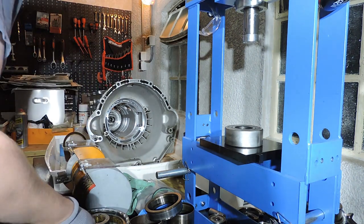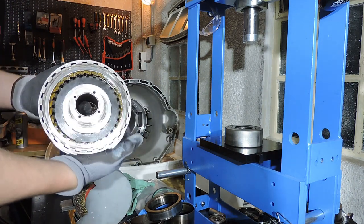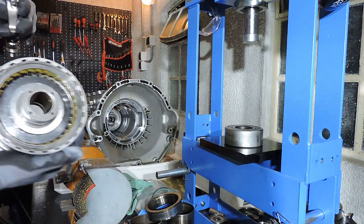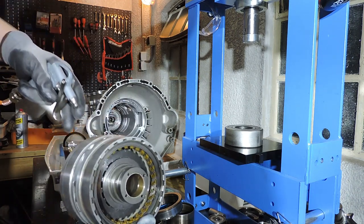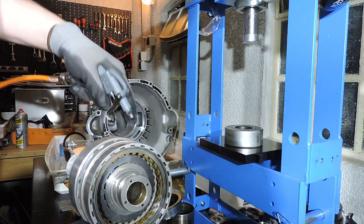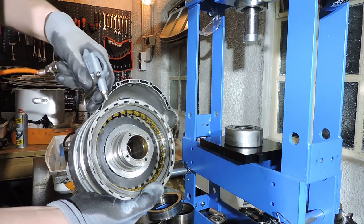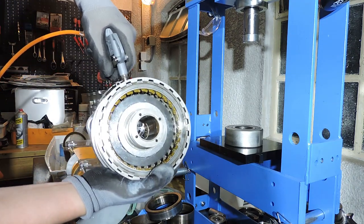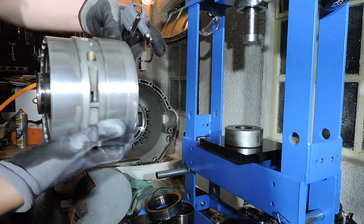All right, got some new gloves. Before we're going to put that DG drum in, we can actually test the clutch actuation with air. And what we want to see when we apply air, we want to see some clutch action. And the moment we release air, we want to see the clutch drop back, because the cup spring takes care of the clutch falling back in the loose position. So let's add some compressed air. That's the clutch action right there. Let's do the underside.